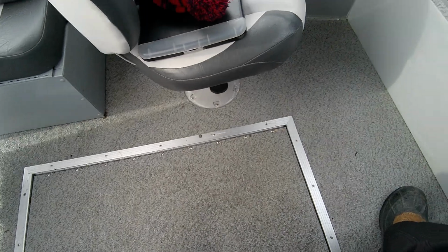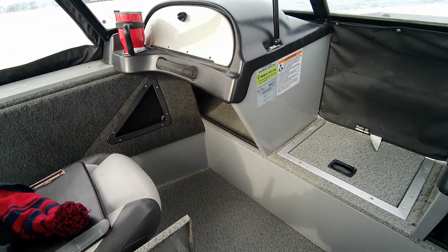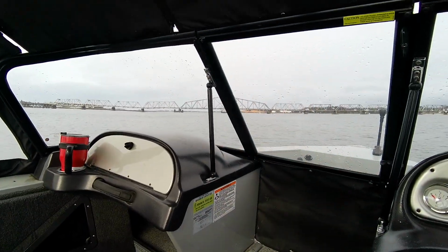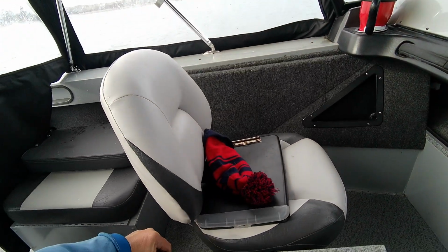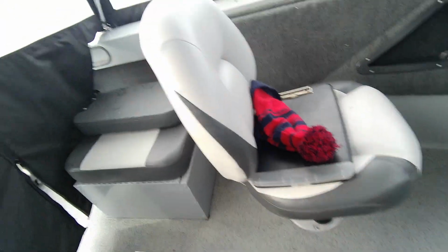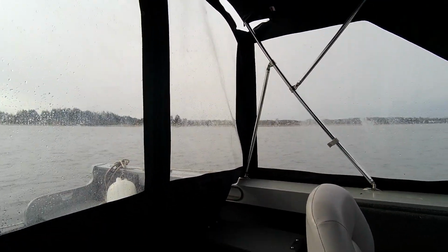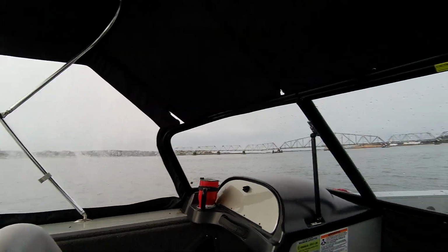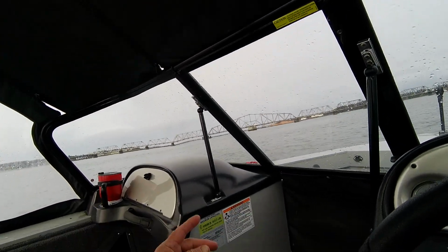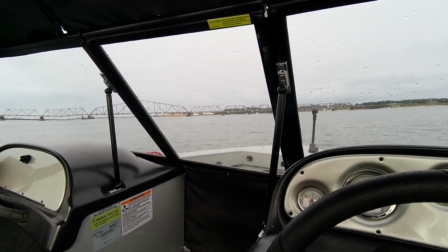And then down in here, they need to clean this out really good. Boat evidently has been sitting. The motor runs really good, about 35 miles an hour. 3 seconds to plane. Plane's at about 20. Cruising's about 25 for the best fuel economy. Real quick, 70's where to go. People used to put 60s on here, but that 70 really helps you out of the hole shot. Six-person, 150 horse. Geez, I couldn't imagine putting 150 on this thing.